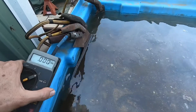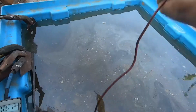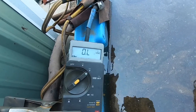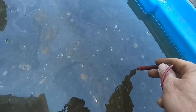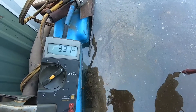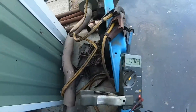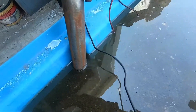I've got a meter on here, which I've got clamped so it hopefully doesn't fall in the water. So we've got some current flow in the water, and it's strongest where these plates are directed towards the block. You'd have to flip the block over 180 degrees if you really want to get the other side better, because the current is less over there. It's strongest right here where the plates are — the strongest attraction. And if I move the probe closer, the voltage goes up, which is kind of interesting.